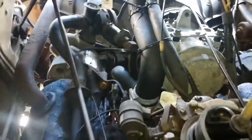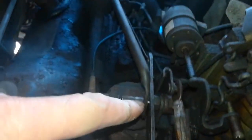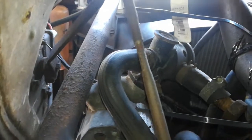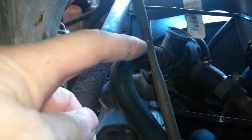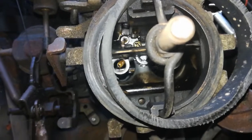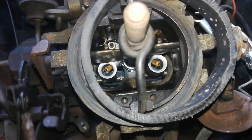What we've discovered, and if you're doing this yourself, it's useful to know, the throttle linkage that goes back up to the throttle pivot has a screw thread, which wasn't easy to spot, but Chris spotted that. So we've now unwound a good probably centimetre of thread, and that now allows the throttle butterflies to open vertically, as you can see, and return and seat fully closed.